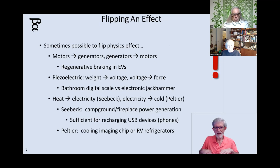You've applied power to the motor and spun the wheels up. Now you want to come to a stop — you push the brake pedal, and it flips the motor's electronics the other way around, so the inertia of the spinning wheels turning the motor actually generates electricity. In the case of piezoelectrics, you essentially apply a jolting force to a crystalline material and it will produce electricity.